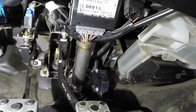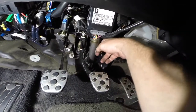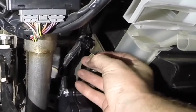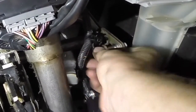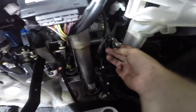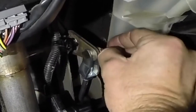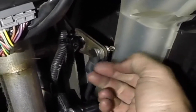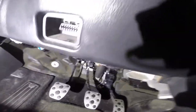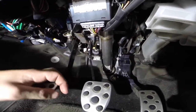We're back in the car under where the pedals are and now I need to put back in place the pin that we took out — that goes right up in there. Just kind of point and shoot with this GoPro, it's kind of a struggle. I just pushed the pin through — now it's locked in. All I have to do is line up the hole and then place the little snap pin in there to keep it from wiggling out. The microphone did not work so now I'm doing a voice-over. Once you get the pin in place you're ready to move on to the final steps. Master cylinder is moving up and down — I'm gonna have to re-bleed the system. Absolutely no pressure right now.